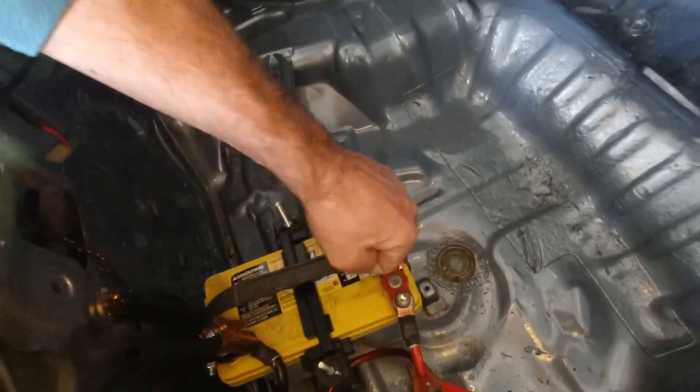It is after work. Super grumpy today so I left the office a little early. Went to the parts store, exchanged the other starter for this one, and had them test it - because this thing just throws massive sparks when I try to hook it up. They said it definitely has a dead short inside. So it wasn't me, I'm not going crazy - well, I am going crazy, but not for that particular reason. I'm going to disconnect the battery when I hook up the starter this time. I got the actual correct one for this motor.